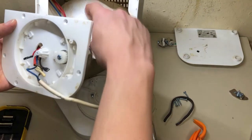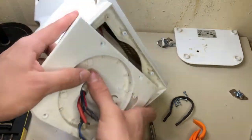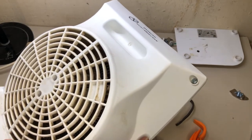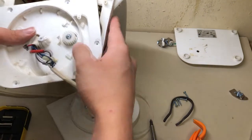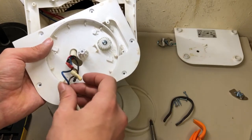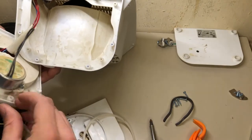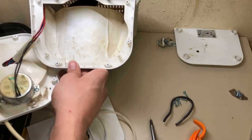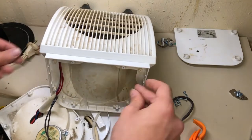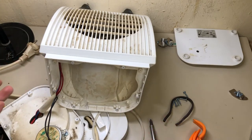Ew, look at this, man, it's a lot of dirt. But now I see it. So the upper part, the front part, is taken off like this. Okay, whatever. At least good I checked that, because I gotta redo this part here anyways and clean the contacts, because that could also explain why it draws so much current. It draws quite too much current, which is dangerous, can cause burnt wires, other problems, or just cost much more money to use it.